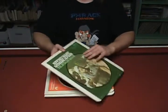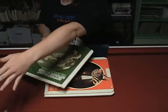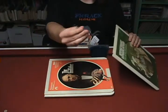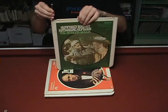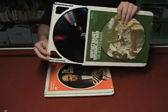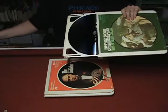I'm going to show you the inside of one of these — you can easily open them. This part moves and makes a little bit of noise. There are holes in here so that when you had a SelectaVision player you would slide it in, the disc would pop out this side, and then you'd pull out the plastic casing, with the disc sitting on something called the spine. To open one up, you take a small jeweler's screwdriver, hold the disc, put it in the crack, push in a little and pop up this side, then do the same for the opposite side. The disc itself is shiny and looks similar to a record — I have a random record here for comparison, about the same size, both 12 inches.